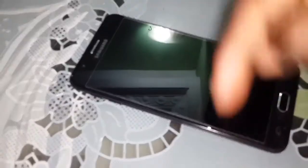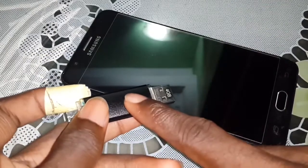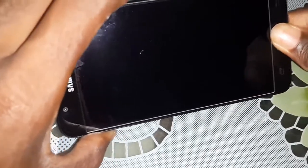This is your Samsung Galaxy J5 Prime. Under this video there is the link to download this ROM directly. Put this ROM on your USB OTG and enter TWRP by pressing the Home button, Volume Up, and Power button at the same time.